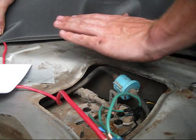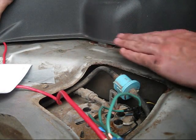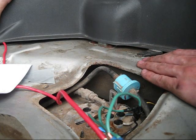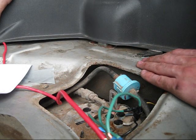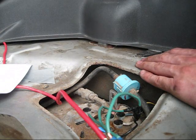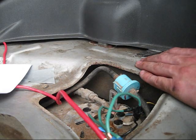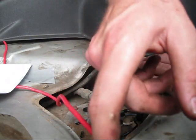First off, if you're going to get in the back hatch, go on Stealth 316's website and he'll show you how to get to this. Probably the hardest part is running the wire from the engine to the rear hatch — passing it through the firewall, then taking the side panel off, running it under the carpet, bringing it up under the seat and getting it here.